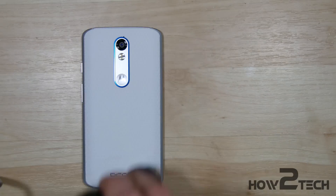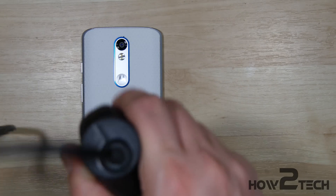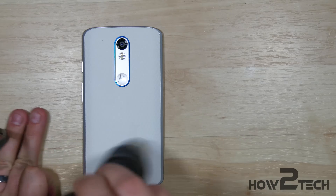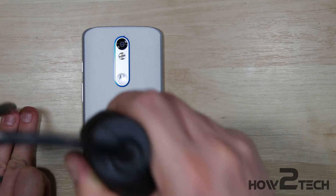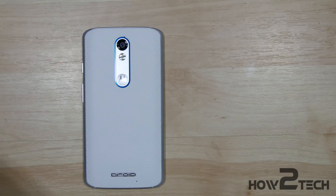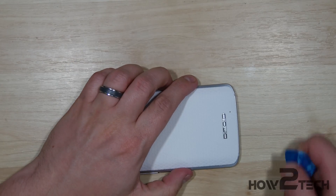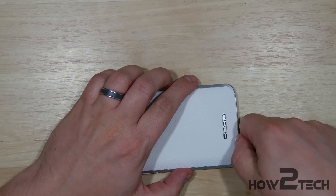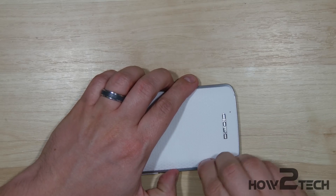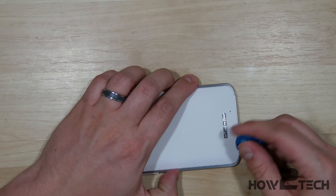The back is really, really flexible, so you don't have to be worried about breaking it when bending it to remove it. But you definitely don't want to damage it by trying to slice it into the side of the phone. We're getting pretty close. I'm going to take a guitar pick here — there's a little gap down here on the side. We're going to try to dip our guitar pick in here and see if we can get it to slide around right through here. I'm just going to give it a little bit of force.